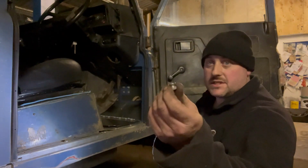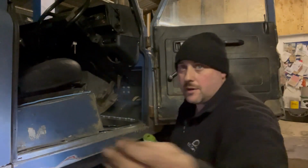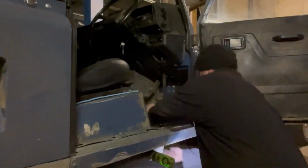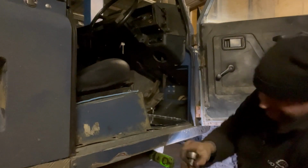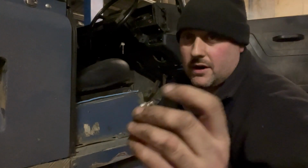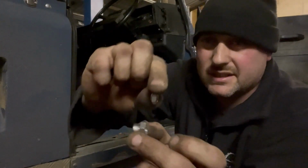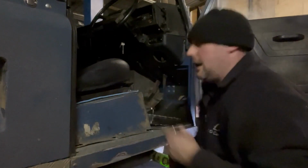Got these snap-off nuts as well. I don't know if you can see that. So as you tighten them up underneath, they will shear and just leave the round bit and take off the hex part. So we'll do that now as well. And there you go. So that's what they start like, and that's how they end. So they shear, so you can see that a bit better. See that? And then it just leaves that dome portion under the bolt.